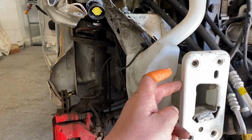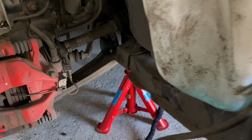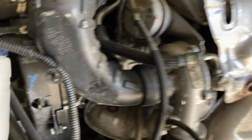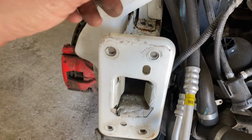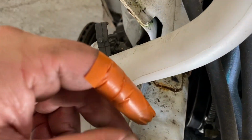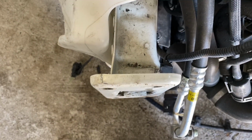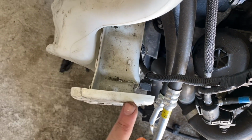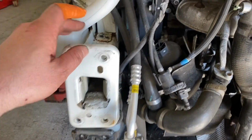And yeah, the actual chassis legs, or these bottom chassis legs, are absolutely fine, both sides, not moved, not been hit, no impact at all, so that's good. That side obviously hasn't been touched because the impact was this side, but this leg here, this chassis leg, has had a little dent in, and you can see my plaster. Yeah, so you can see down there a little crease. So it looks like, as you can see, it's had a little push, so it's pulling back out a little bit. But apart from that little pull, it doesn't look that bad.